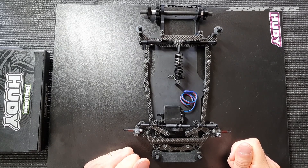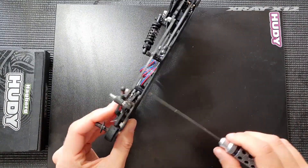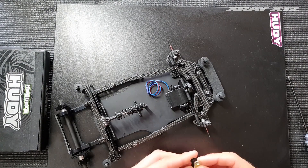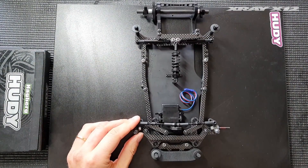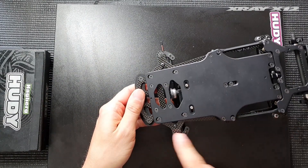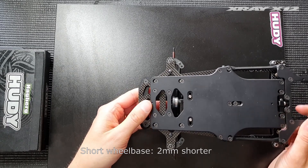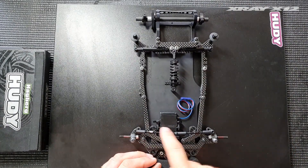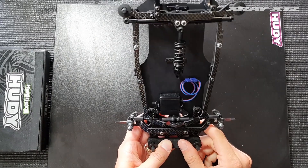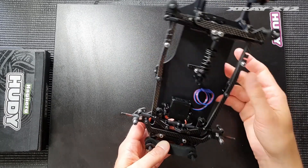I'm going to show you exactly the change you need to do when shortening the wheelbase. The wheelbase change is done — as you can see I've moved to the shorter wheelbase, which is two millimeters shorter than the kit long wheelbase. The steering links have now moved towards the back, swept rearward, and that's an Ackermann angle which we don't want.